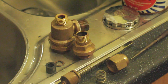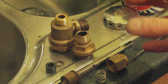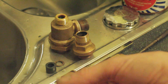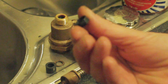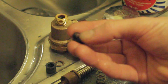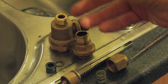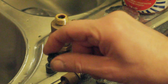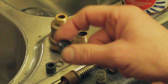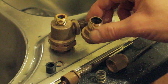This is the steam tap, which is disassembled — both have been stripped, rubber seals and bits taken out, and the remnants put in the citric acid descaler. I'm going to go through the reassembly. This one does need a new rubber seal — this rubber cup seal has a bit of the lip broken and has become quite brittle. I don't have a spare one yet. The other tap's seal is okay and still has some flexibility, but this one is subject to much higher temperatures being the steam wand, so I do need a replacement set.